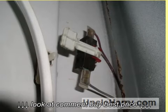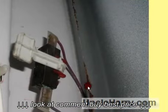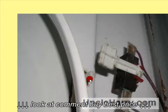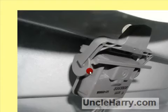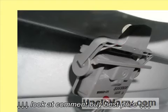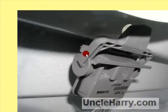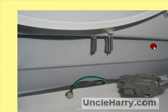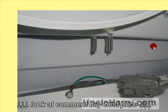But back to the washer. Here's the original style lid switch. It's a micro switch being activated by this pointer sticking down through the top of the machine. This is the more recent style. There's even one newer than that, but this is the very popular one, and with excessive use or an off-balance load, this thing will be broken loose and need to be replaced. Lid switch replacement, very common reason the machine will not drain or spin.